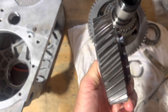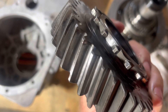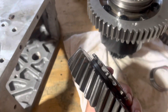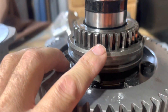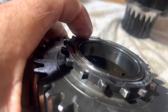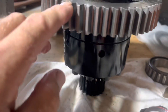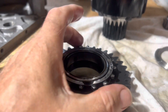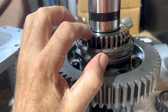Output gear with bush. You'll notice the dog teeth on this are thicker — that's because this is an earlier case. I think late 80s; early 90s they went to the thin dog teeth. When we compare the high-low hub, the teeth are much thicker across there, much stronger, as are the dog teeth. When we're talking gear strength, all of the drive force is taken through the dog teeth by the selector ring through the hub, which is splined to the center diff.